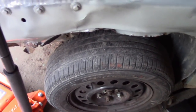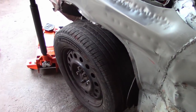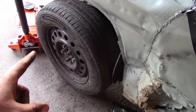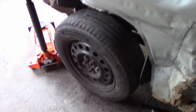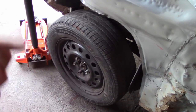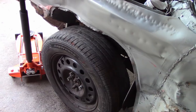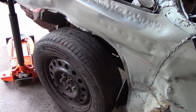However, here's a small lesson before you put a ton of work into fixing something. Now, we have done a ball joint, fixed the tie rod, replaced a rear hub that was broken on his. We also knew that we had a tranny leak, and we had rolled around under there a little bit, and we thought it was leaking from the lines going into the tranny. Figured worst case scenario, a little bit of stop leak, maybe a rubber hose with some good clamps or whatever the case may be, would find a way to get those lines to stop leaking.